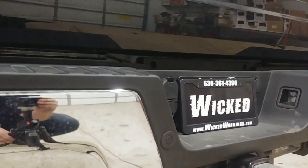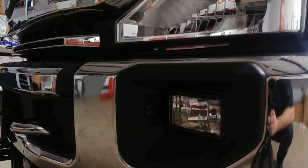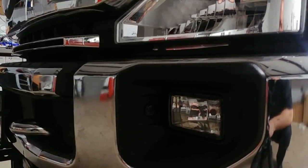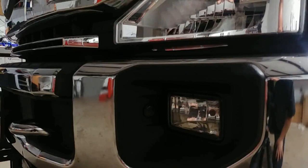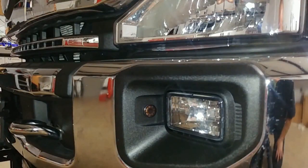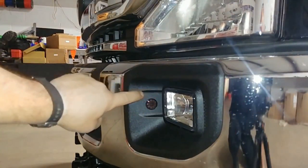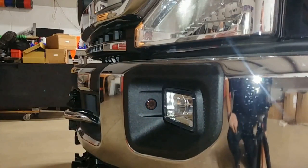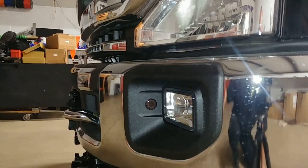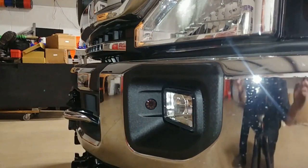We ran all the wiring right behind the bumper, left it easily accessible and tied up behind the license plate. Speaking of the fog pocket — this is our LED HAW DUO, low dome, one-inch hole, back mounted, glued in place with a little RTV silicone and smoked. It's an amber color, and you can see why we went with the one-inch DUO here because of the radius and the low design — a T3 doesn't fit that well, so the DUO looks really nice. If you have a 2020 Super Duty with this style fog bezel, make sure you have this specific style, as the other LED fog lights are not the same.